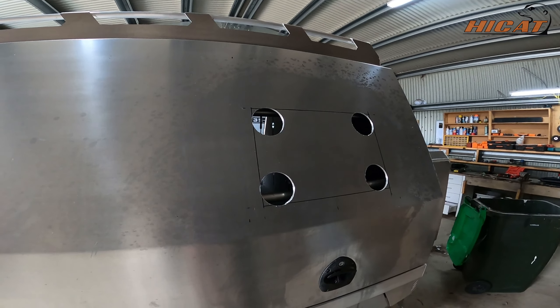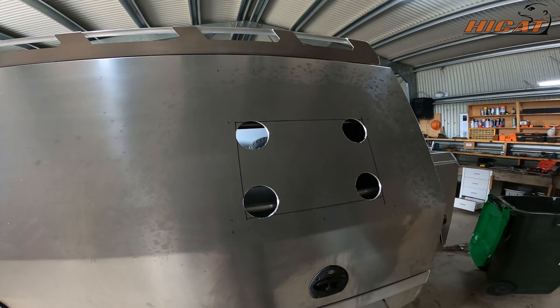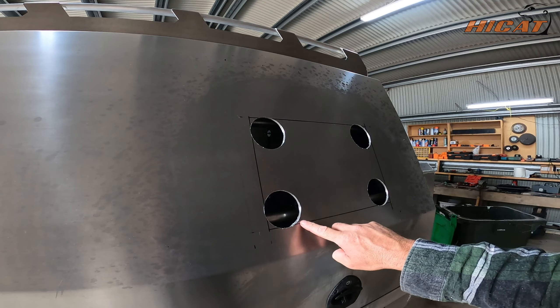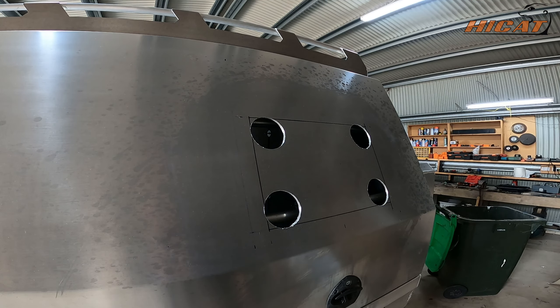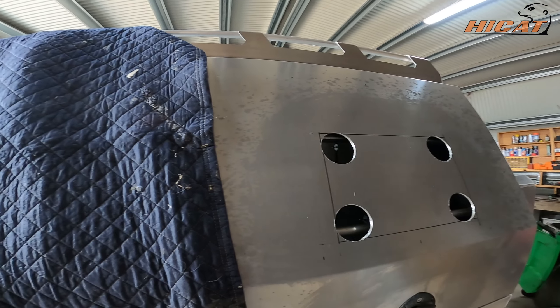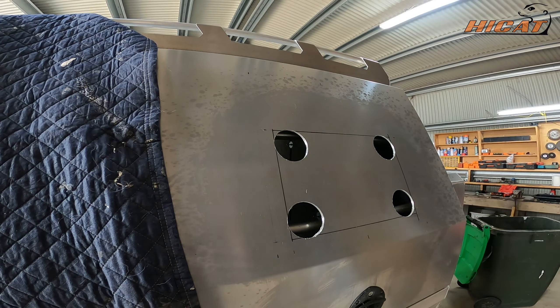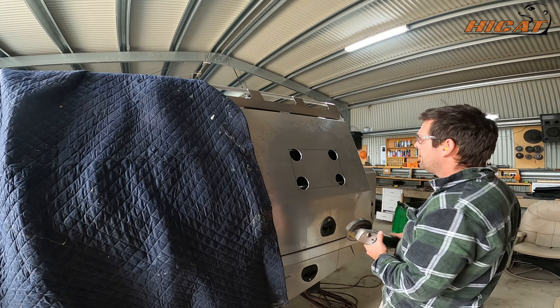Now we've got the holes drilled. As you can see, the bar behind there lines up perfectly. The holes are a little bit rough — we'll tidy them up later with a file. We're just going to cut between the holes on this line, a little bit outside it. It's not really going to matter as I'll have coverage. I'm going to do that with the grinder — you can use a jigsaw or anything else with the appropriate blade, bearing in mind what's behind there. Now we're all prepped and ready to cut. Don't forget to cover your paintwork and glass; hot metal is going to eat into both. Use your PPE — earplugs, glasses, gloves, whatever you've got. I'm going to start with top, bottom, left, and finish on the right — makes it easier.